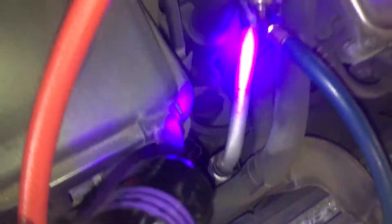But you don't stop there. I still have to test the evaporator inside. You go over, do your visual, follow all your lines, going all the way back to the firewall and then back down, get up underneath the car.